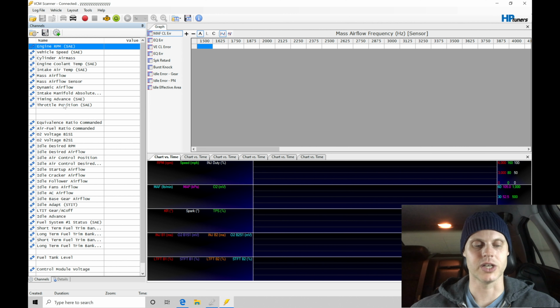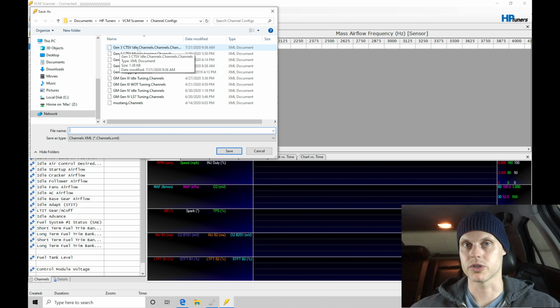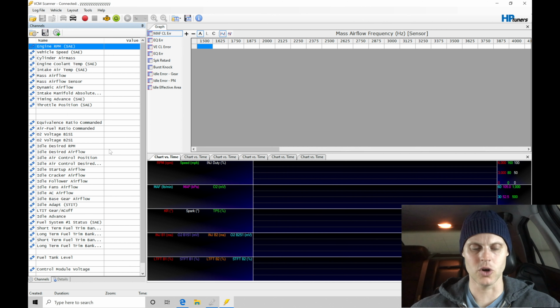And again, our PID channels list, if we go here to save, is going to be saved under Gen 3 CTSV idle within the course directory. You'll just be able to download it right out of the zip file and open this up if you want to follow along or use it on your own personal vehicle.